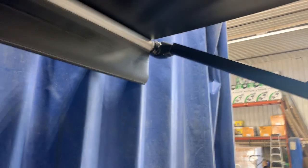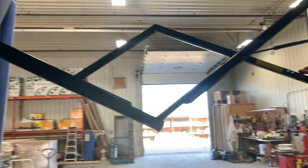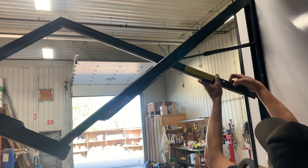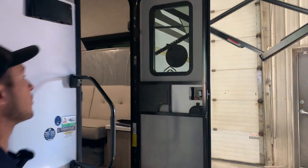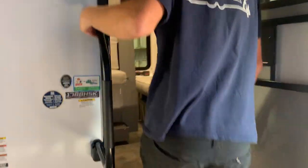If you like that angle better, you can do the same thing with the front arm and it's going to allow for more shade underneath. Just always make sure you release those guys back to their normal state before you bring that awning in. To bring the awning in, you're just pushing that button down — the awning will make its way in, and once it contacts the side of the trailer the motor will just cut out.